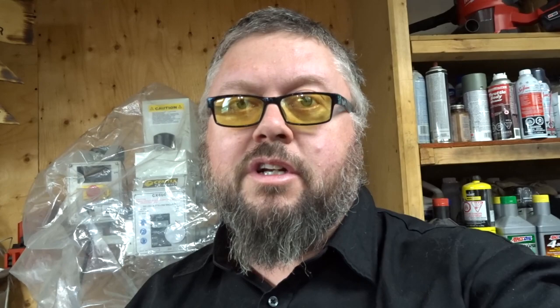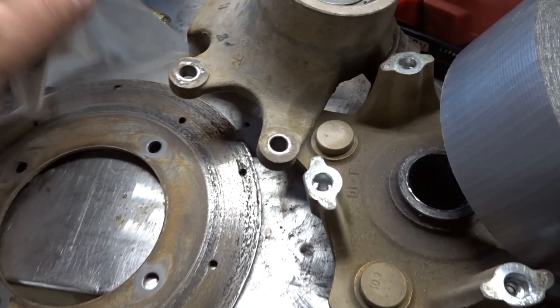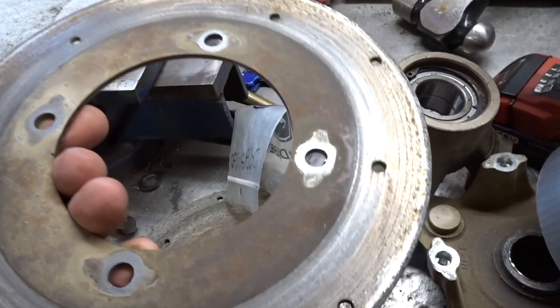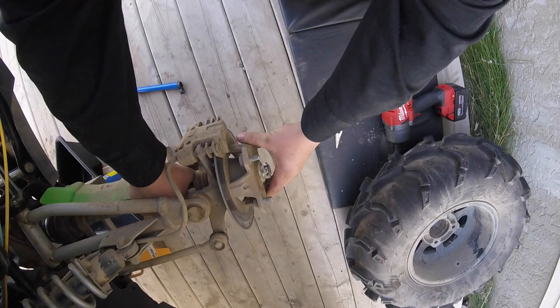New axle should be here in a couple weeks. I can put the brakes on the other side and wait for the axle to come in to finish the job off. I did meet up with that guy for a rotor - got the new bolts as well, $15 for a used one. This rotor is actually quite a bit more worn than my other one, and this one isn't straight anymore - put that on an ATV and the only thing it's going to do is wobble its way around.